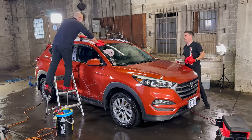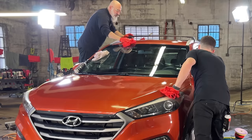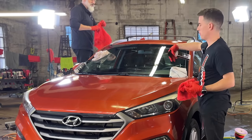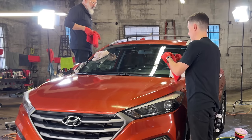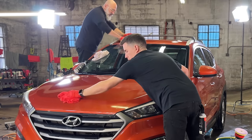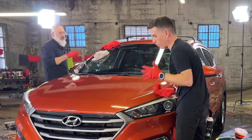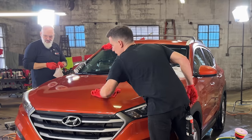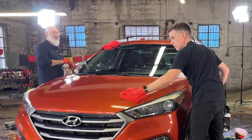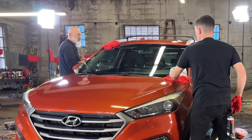Both sides are matching now. I started to polish and almost forgot — we wipe off after every panel. That makes it more satisfying because once you're done, you're done and can see your results immediately. If you were applying a ceramic coating after this, you'd polish the whole vehicle and leave the polish on. The difference here is you want panel prep on the surface as close as possible to when you apply the coating, so dust doesn't resettle.